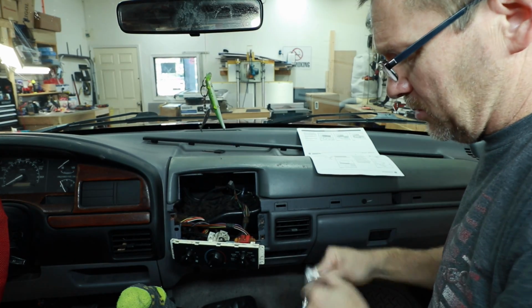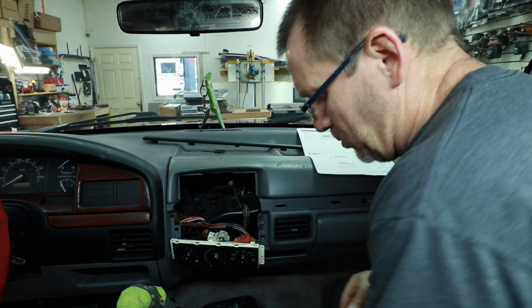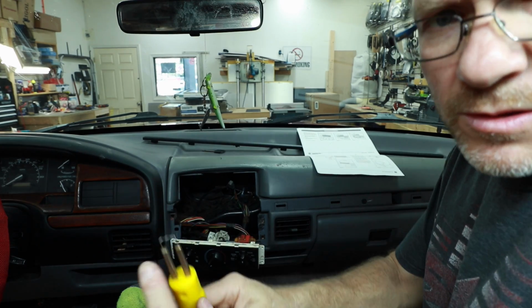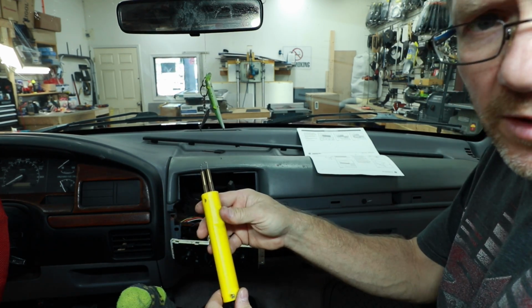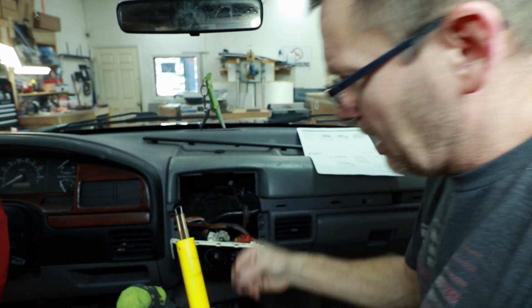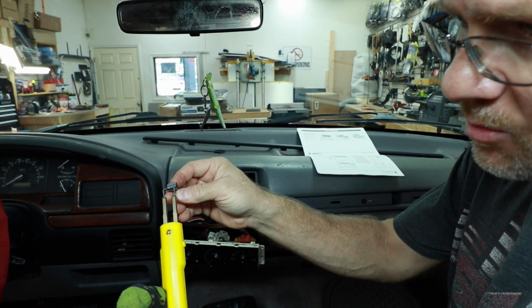On this side, we're going to be using the plastic stapler. This is designed to put body panels back together that are plastic. How it works is it takes this little staple here and uses it as an element. When you press this button, this is attached to a whole heating structure. It gets red hot and it allows you to put it across the two pieces that are broken and thus bring them back together.